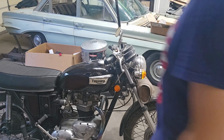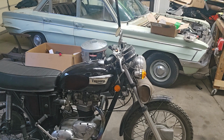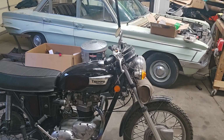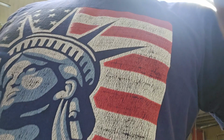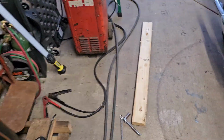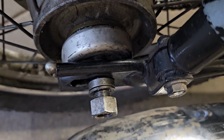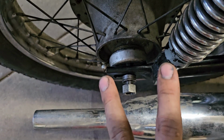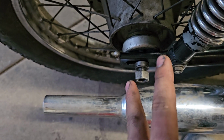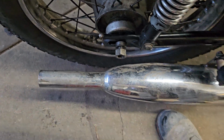Yeah, the bike is back very nearly all the way. I just need that speedometer housing. Just to show you that speedometer housing, let's flip them. That speedometer housing is this guy. I installed the old one, but the gear is out of it. This one's a little broken. Pretty sure I installed it wrong. There's 2 little notches on a sleeve that's hitting the wheel hub, and I did not locate those notches. And I'm assuming when I bolted it together, I just cracked the housing and it broke the gear. So, gotta get a new one.